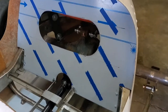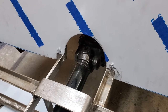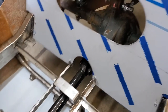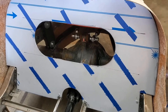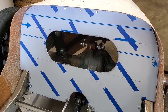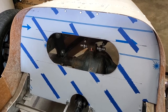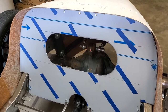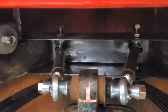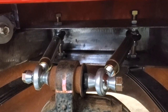I also had to trim out around the drive shaft for clearance — pretty simple stuff. Just a compass to scribe an arc so the radius is about a half inch greater than the top of the drive shaft at full suspension compression. Then there's the awesomeness — one of those innocuous little things that ends up being infinitely cooler than expected. For the interior so far, it'd be this pass-through in the bulkhead. It allows you to reach back and adjust the ride height, adjust the upper control arm angles, and adjust the tension on the shock absorbers, all without having to remove the tail off the car.